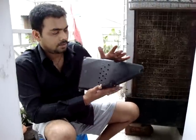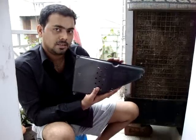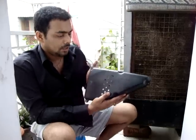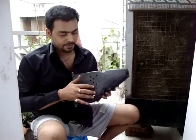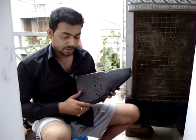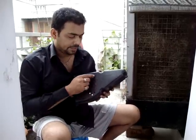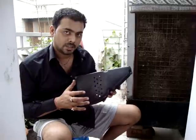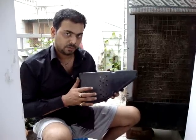This is the cover of a normal stock airbox of a Yamaha SZ 153cc single-cylinder 4-stroke engine. What we are doing here is a very basic and very effective modification that involves just drilling holes in the cover of the airbox, which allow extra air to come in without much of the restriction which is usually there.